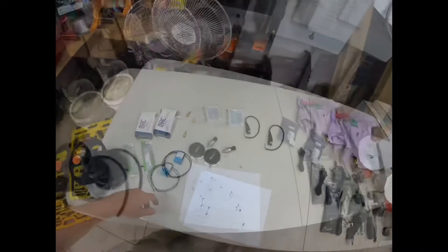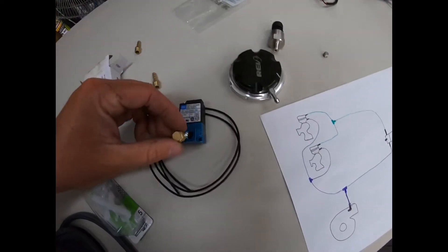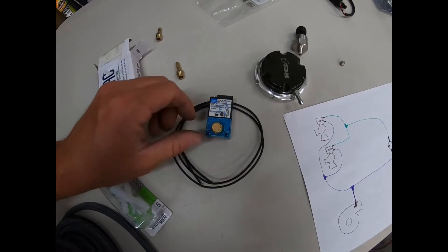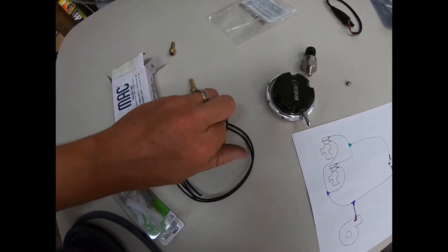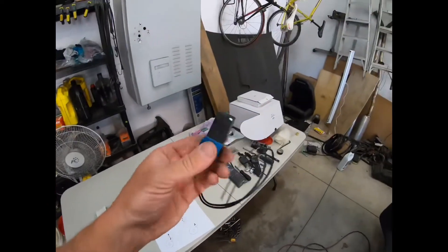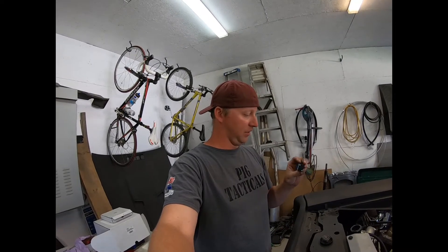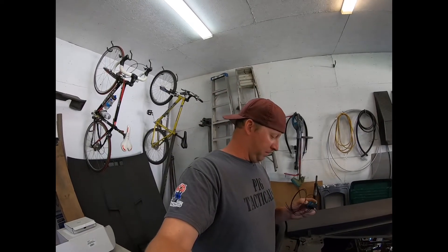In case you're wondering what port number three is on the MAC valve — it came with a little vent fitting. All that does is vent the pressure when you no longer need that amount of boost. So you've got your in, your out, and your vent — that's how that works. As for mounting the MAC valve, they sell a bracket for these things but it's like another 20 bucks, and I wasn't really thinking about that when I bought it. I'll figure something out — I might just zip tie it down out of the way where you don't see it.